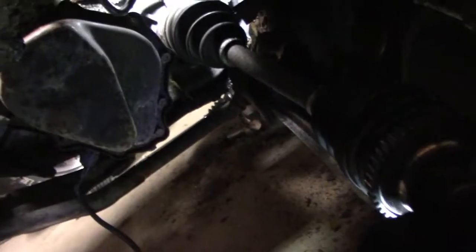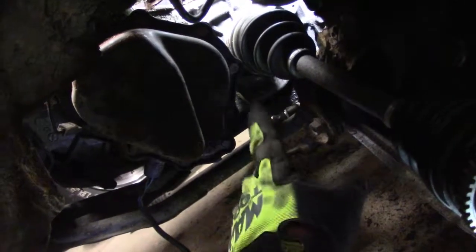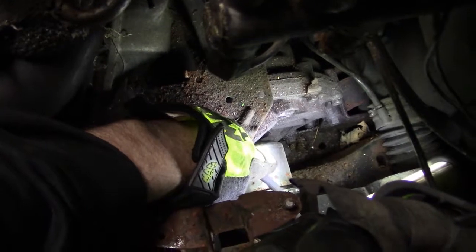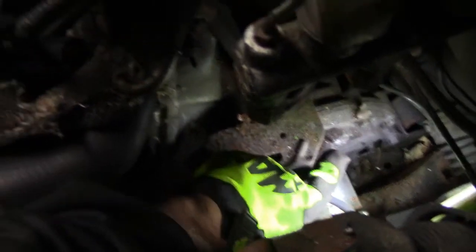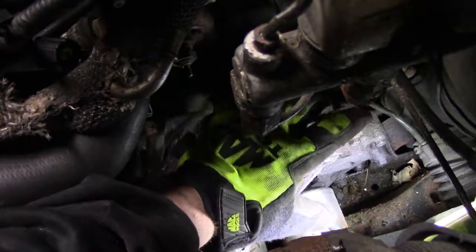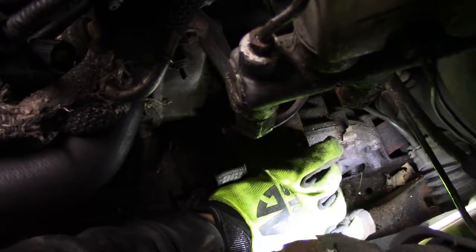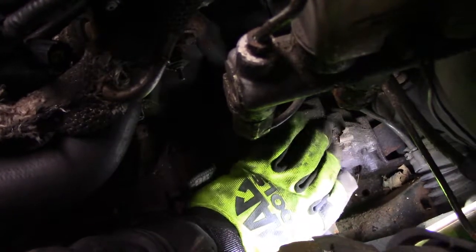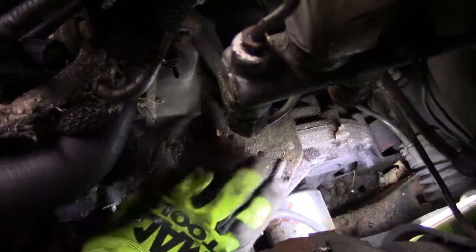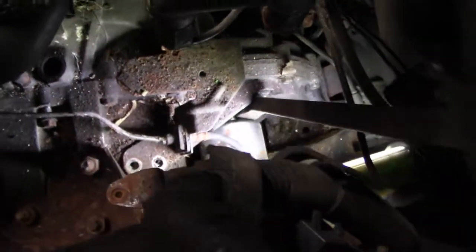With the CV axle out, you can usually just use a pry bar going from underneath the car. I can't get a pry bar between the transmission and the axle, so you can actually go on top. That's the end of the CV axle that goes into the transmission. When you have the other side pulled with these out, you don't want to twist them at all — there are spider gears inside. With these CV axles out, the spider gears can slip and mess up inside the transmission, which means you can't get the axles back in. Usually you have to take the transfer case or the transmission apart and reset them. Have it in neutral and try not to spin the axle. Usually take a long pry bar if you can get it down there. There's a seal that you don't want to damage.